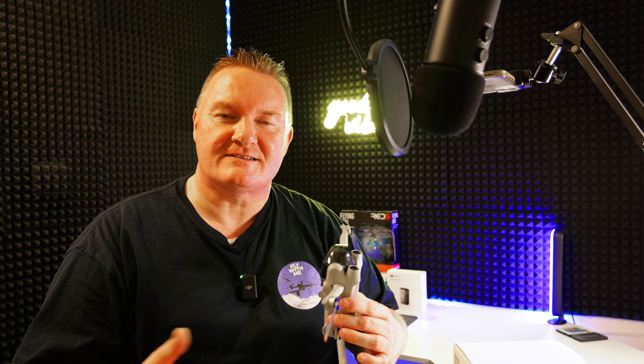Inside here there's the battery charger — so there are two batteries in here and I'm assuming the third is already in the drone. The battery actually forms part of the drone itself. This one is a little different to the Fly More kit on my Mini 3 Pro: instead of charging one at a time, if you use a powerful enough charger it will charge all three at once. I believe it needs to be a 60-watt charger; at 30 watts it might do two, and less than that just one at a time.